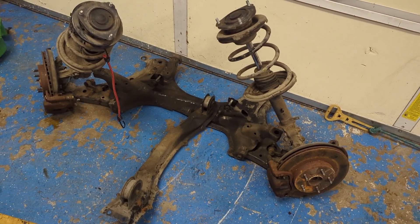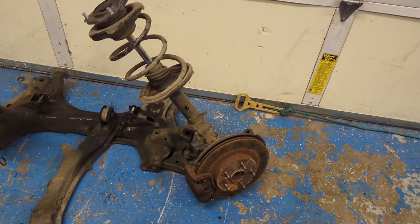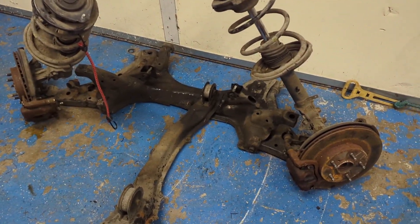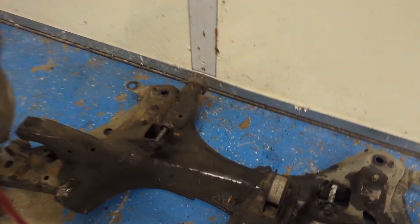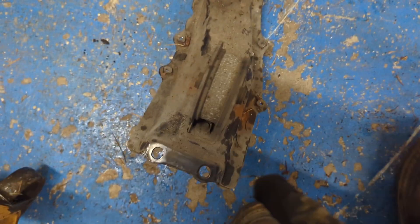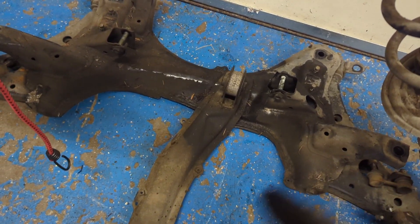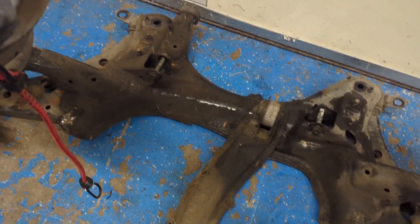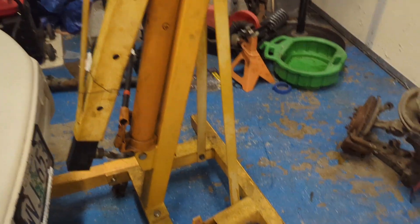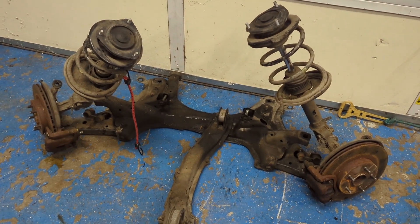We got the engine lifted out of the cradle. As you can see, there are your two forward and backward mounts. I'm still leaving my struts and everything hooked up just so I can get everything clean before I start really disassembling. Both of these mounts are actually pretty similar in style — they both have a single bolt, and then the mount on the transmission side has an encapsulated nut that holds everything in place. I used a cherry picker to get everything pulled out and a couple jack stands to set everything up. Now that part is ready to be cleaned up and painted before the 3SGTE goes in.